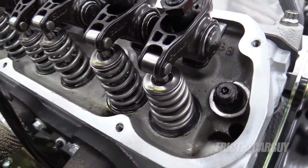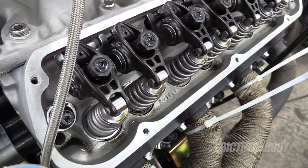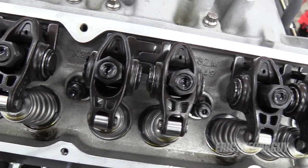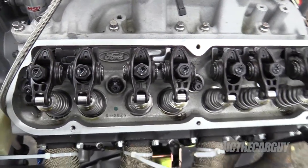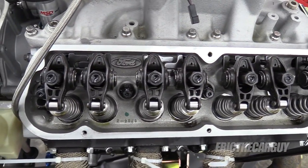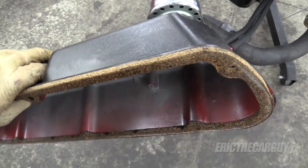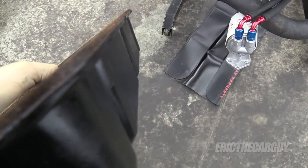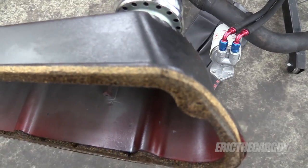We really never got the opportunity to see this stuff up close and personal. We only scheduled three days for the engine shoot, and unfortunately it took more than that. These are the roller rockers from Comp Cams — they're not aluminum, they're steel. Although if I were to go back and do this again, I might want a shaft rocker setup. They're just held down better, and I think would hold up better. Now these valve cover gaskets are pretty much glued onto the valve cover, so I'm just going to leave them on here. They're perfectly good gaskets and will work again on something else.